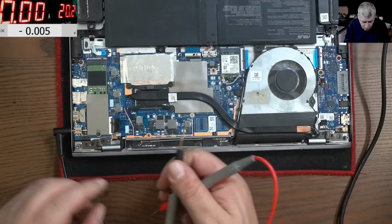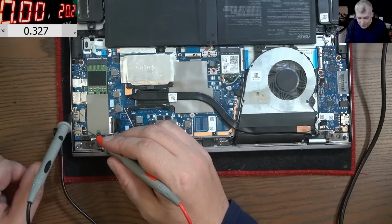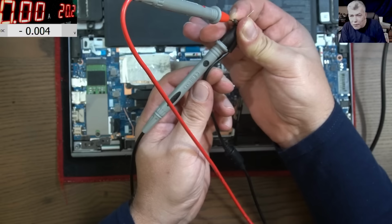Let's try a trick. Yeah. Let me move the cable. Check now. Now it's 19. You can see. 0 volts. One more time, 19. And you have the orange light there, yeah? So what is the fault, the charging port? No, it's the charger. Zero. You can see? 19, zero.